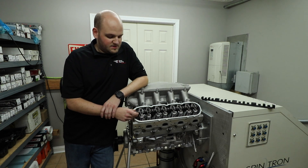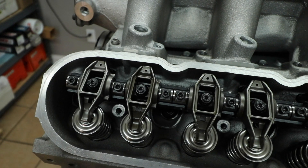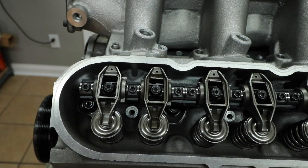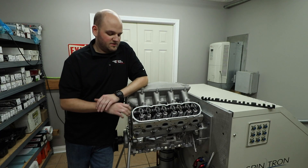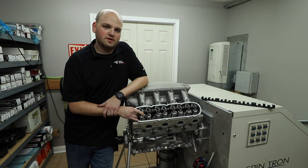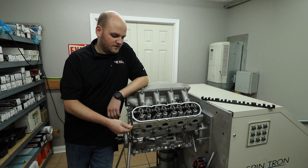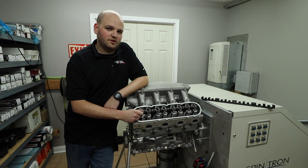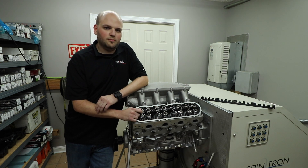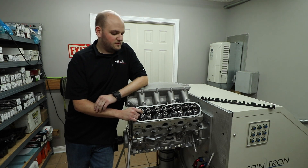Accompanied with the steel stand, we obviously have the three extra bolts here on the stand, as well as the two bolts that we would have on a normal application. We believe that the steel stand itself actually braces on the cylinder head, and the cylinder head casting itself is somewhat weak — that's where we're actually seeing deflection from. Also, inside the rockers we have needle bearings instead of a bushing. That was a big requirement of mine because I prefer having a bearing instead of a bushing. That's about the main benefits of this setup.